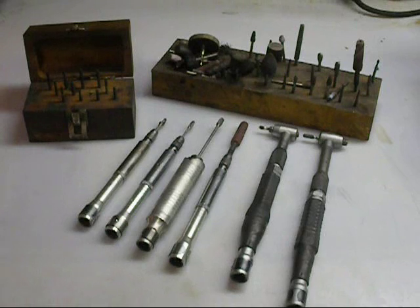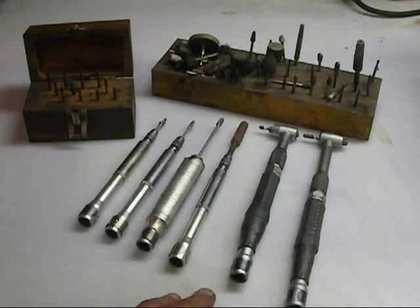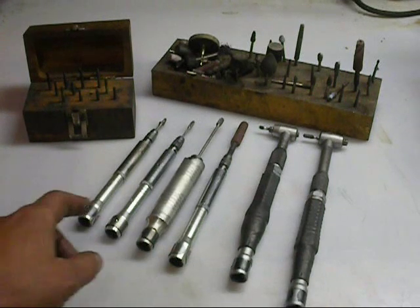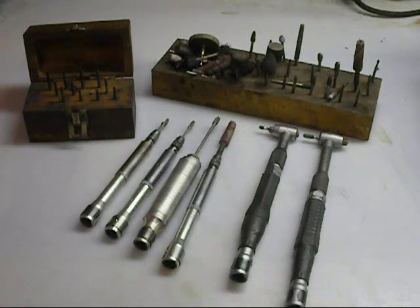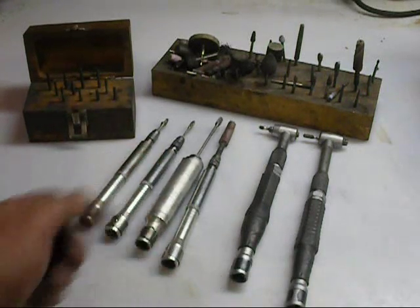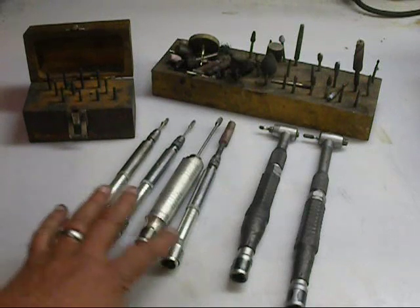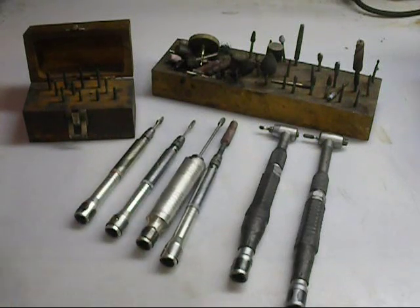Here are the tools we're going to use to port the cylinder. We've got a couple of right angle grinders — one set up for grinding the left side, one for the right. I'll explain that later. I actually like these; they have a smaller profile. A lot of stuff I work on is fairly small in bore diameter, and they work really well for bikes too. They're not as tough as the larger type of grinder, but they're cheap — you can replace them for about $65.